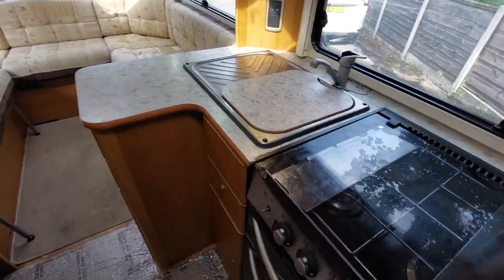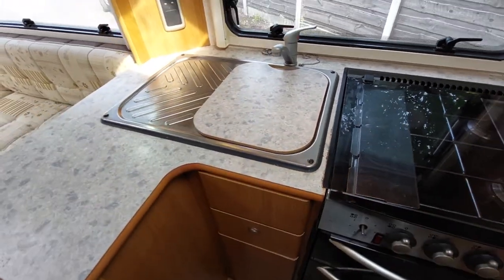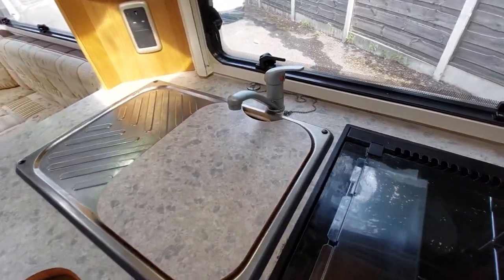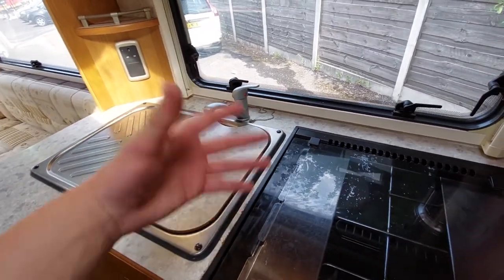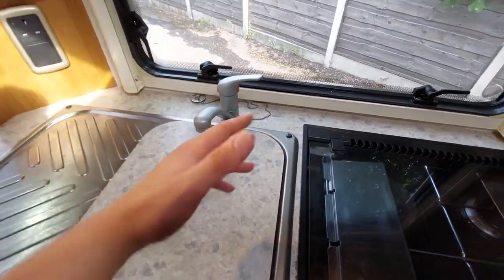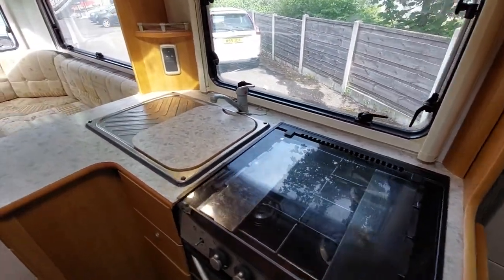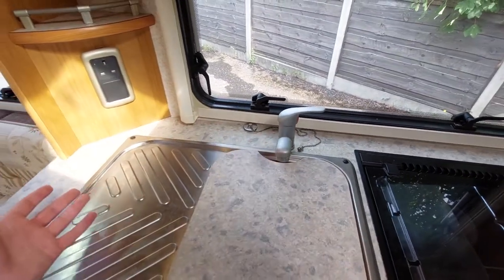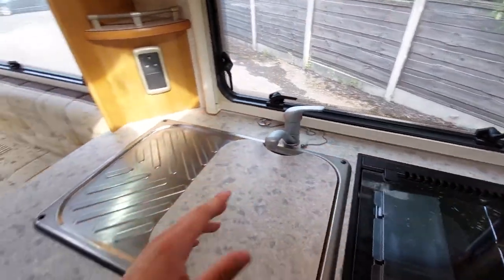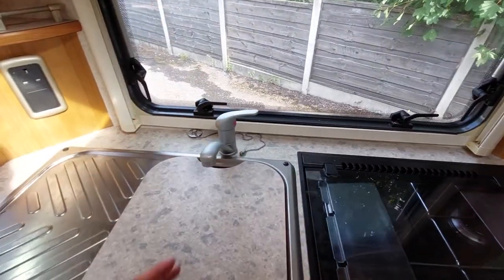Your pump — you need to make sure that you've got water in your system. Once you have, go to your taps including your shower, turn it on and turn it to hot. That will pull water from the fresh water tank into the boiler and then out of the tap. Once it's flowing out steadily you've primed your system for hot water, then flick it to cold and do the same. You should only run the pump when you are using the water and when you've got water in the system — otherwise you will burn out the pump. The reason to prime on hot first is to pull water into the boiler so when you turn your heating on it can start heating the water. By the time you've set up on site — about 30 to 40 minutes — that water will be up to temperature and ready to use.